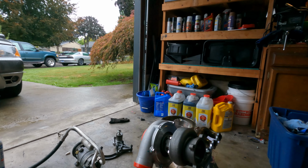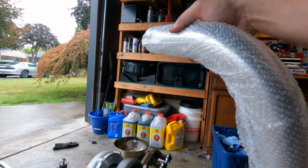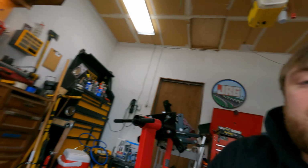I wanted to get it set up like this so I can get a visual of it, and that's why I also removed the air conditioner from the Camaro. Looking at this 2.5 inch, if we use 2.5 inch exhaust piping, I feel like we'd easily snake that down where we need it to go. 3 inch, I have some 3 inch straight over there. It is actually a pretty significant bump in sizing and diameter, so we might need to go 2.5 inch. We'll just have to see.